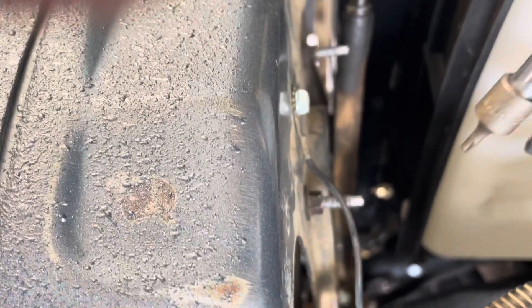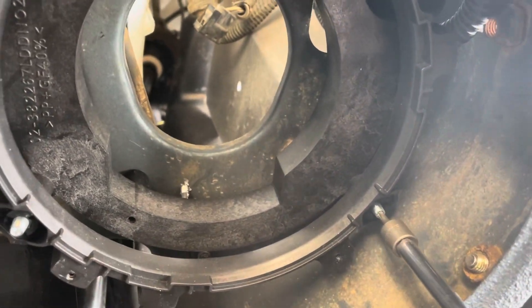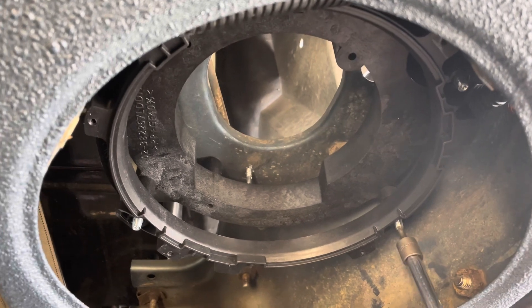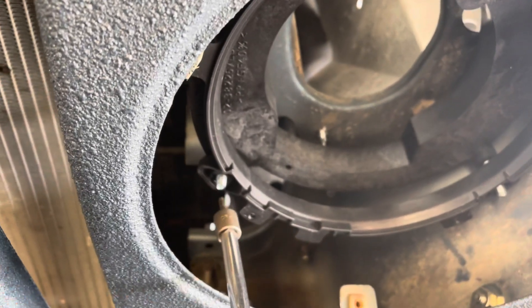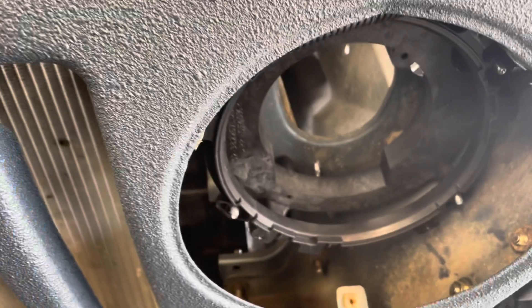There you go. I've got the second one seated and bolted in here. With the adjusters, if you loosen them it'll bring the mount out towards you, and if you tighten it, it will press it down into the grille more. So you play with that until you get your level setting.